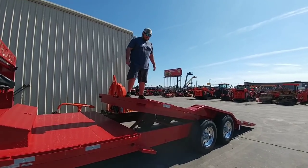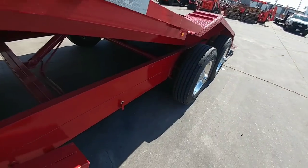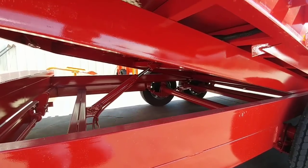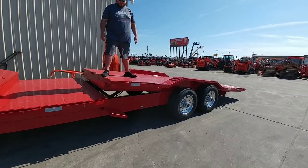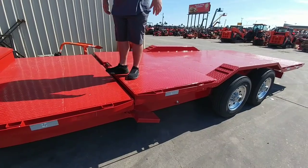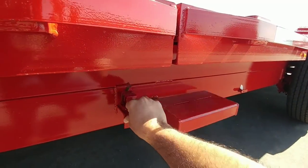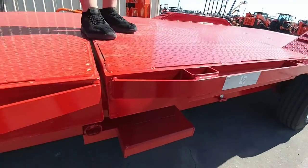There you go — it's like a trampoline! So once you bring a vehicle up here, you simply have to go to the valve and it's going to allow the hydraulic fluid to go throughout the line. You'll see how it will start dropping down on its own. Once it gets to the bottom, if he hops down on it, you'll see where it locks in place. Go ahead and hop down — it's down. So now I'm going to pull it out and now it's locked in place. One thing you want to be sure to do is to pull up.